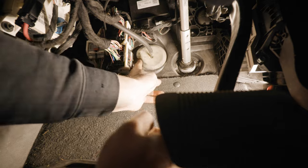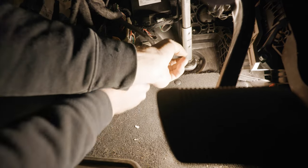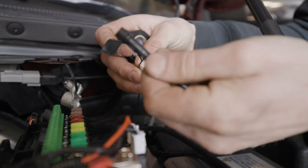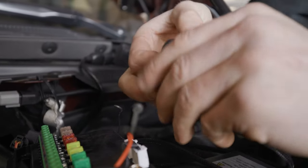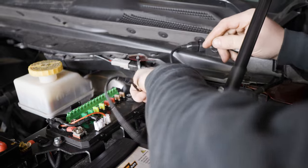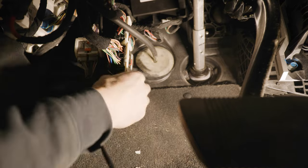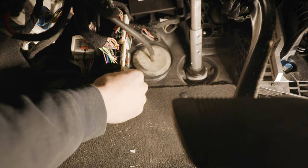We are going to feed some mechanics wire or a coat hanger through and up into the engine bay. I put a loop in the end of this mechanics wire, tape the connector that goes to the 8-gang panel to it, and then pull it through the grommet in the firewall. Pull the wires all the way through and leave about 6 inches of slack on the other side so the wires aren't strained.